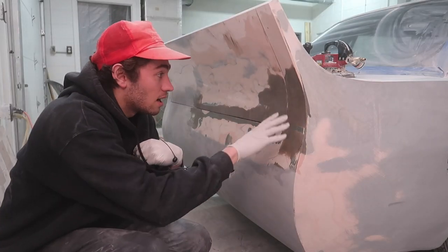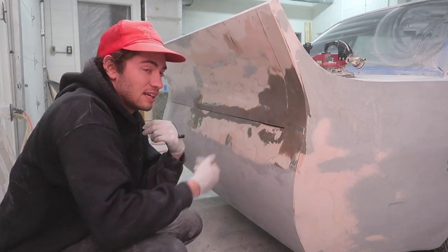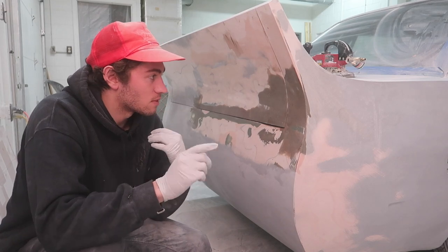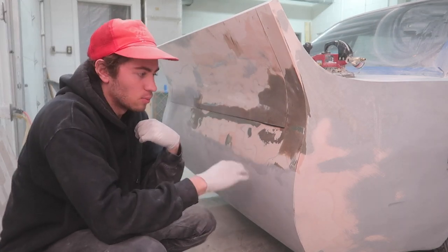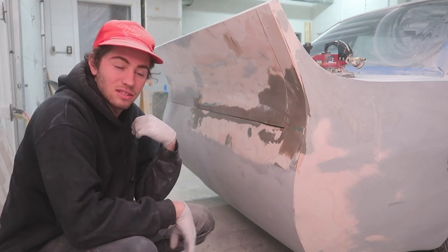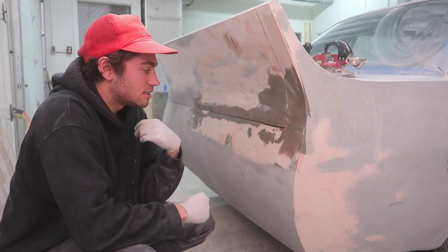We're going to be adding some Bondo on this. I'm gonna put some cardboard in here, and actually thanks to a suggestion by one of the subscribers, he said to put tape on the cardboard so that whenever I tear away the cardboard, it doesn't really stick, just a little bit of the tape sticks.